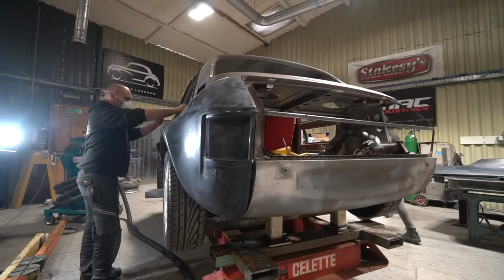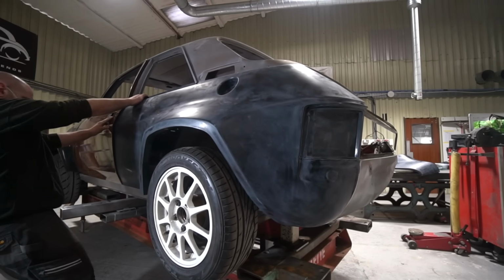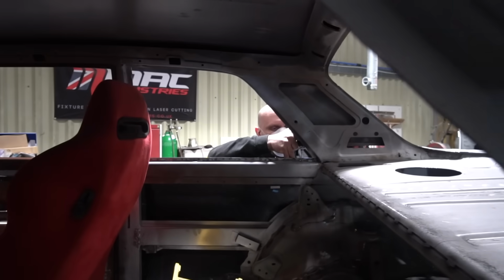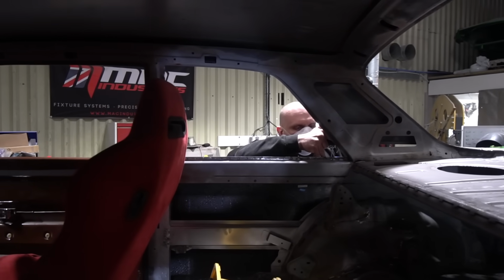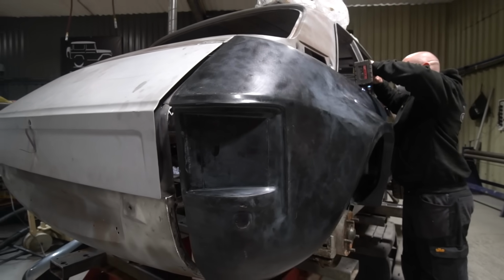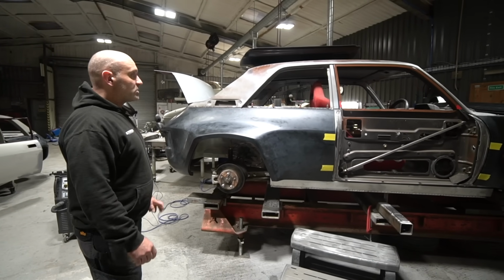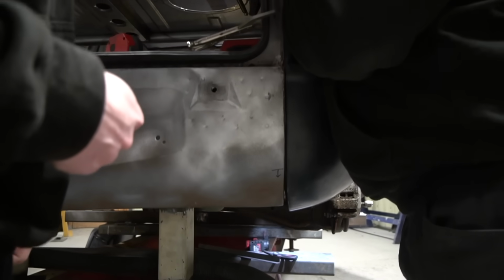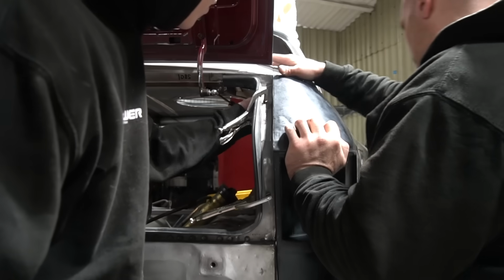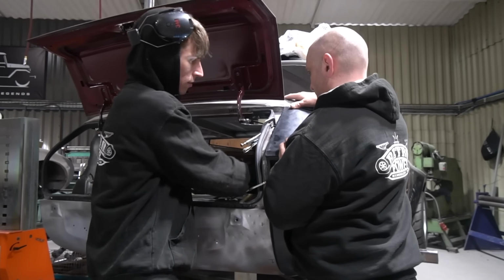Bear in mind that the whole thing was scanned and designed purely on a computer, on a 3D model, if you wish. And the fitment from being completely virtual to actually having a physical part and fitting it on the car, it's remarkable. You wouldn't expect any more, to be honest. Yeah, so panel fitted, the rear quarter, both sides are done. We just had it temporarily with clickers on the top flange and some bolts around the flanges where later that will be bonded to the body.